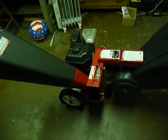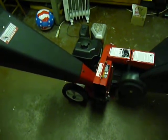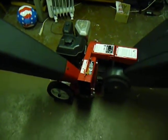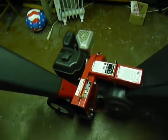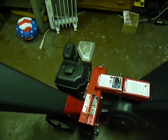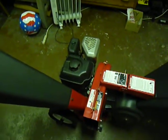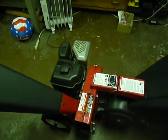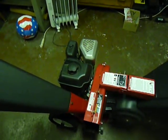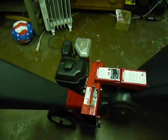It's full of oil right now — a mix of 30 weight and 10w30. It should have straight 30 in it but I didn't have any. I'm probably not going to run it very long because I don't want it to overheat. With small engines, multi-viscosity oils heat up faster; straight 30 is a heavier weight oil and that's what they're really designed to run on. Some older ones can run on different oils — I have an old Wisconsin that 10w30 is actually recommended for.